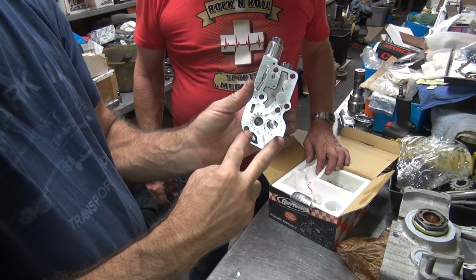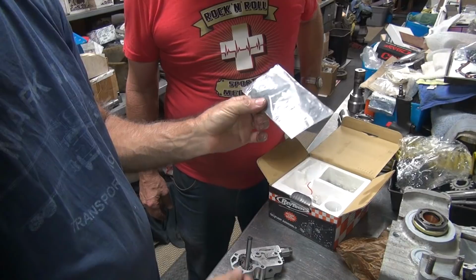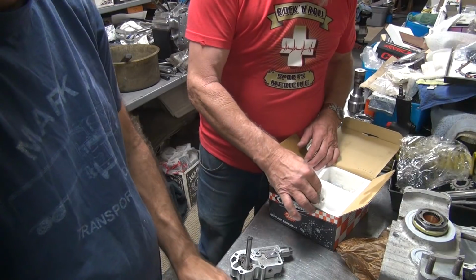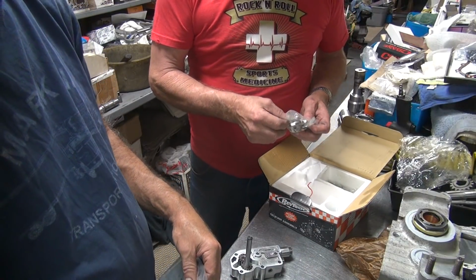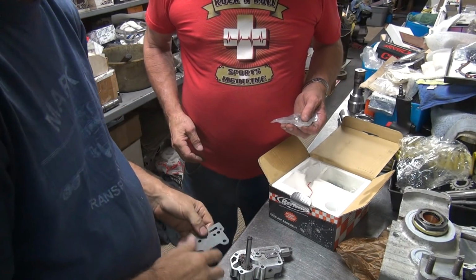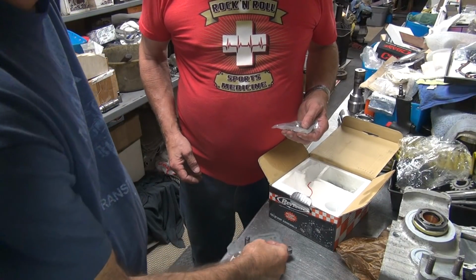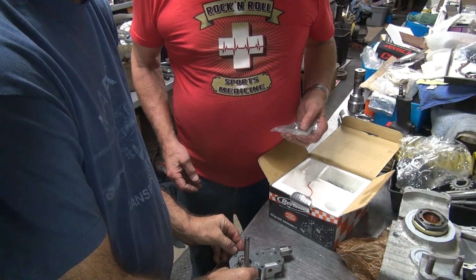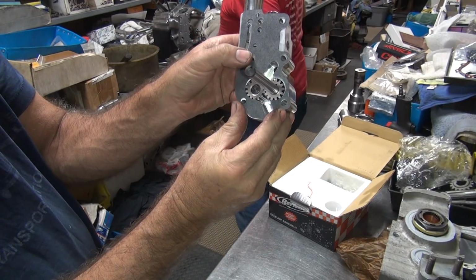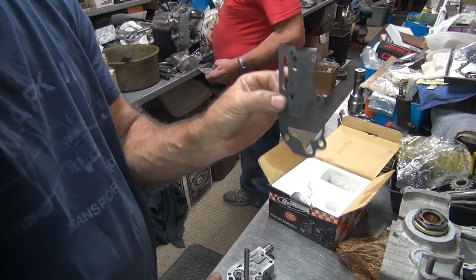These two bolt pattern here. Late pump's wide, early pump's narrow. Here's your gasket. Where's your bolts? Now, if this is a good tight hole, you can tell by that, but if it's loose, you can't tell. Okay, see how that lines up perfectly with the bolt pattern? It lines up perfectly right here, these holes in the bottom. So now you put that on the case and see the gasket lines up on the case.